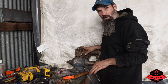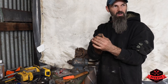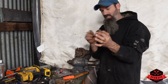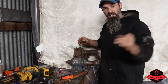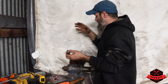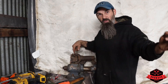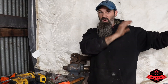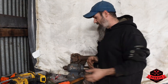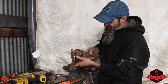We got that cap out and measured it: 1.188 inches diameter and four inches wide — so that confirms this is a 1410. The other drive shaft for the front has the same diameter cap at 1.188 but it's only three and five-eighths wide — that's a 1350. We've ordered two U-joints so we have an extra to reduce this 1410 down to a 1350. Our original rear drive shaft is going to bolt right in as our front drive shaft — length is perfect, everything is perfect.